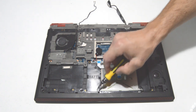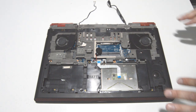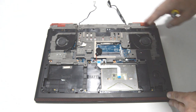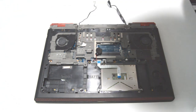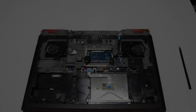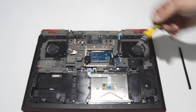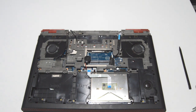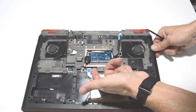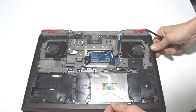We're also going to leave these screws that are holding the touchpad assembly to the palm rest. Give it a final check, make sure that you didn't miss any screws. Looking pretty good. Then we can just flip it over and release the palm rest — looks like I missed one screw here. Then we're going to disconnect the palm rest ribbons, so just flip those little connectors up with your fingernail and pull them free from the motherboard.